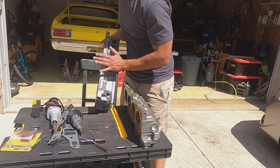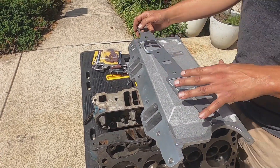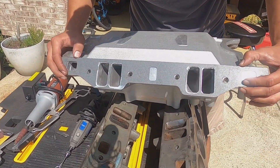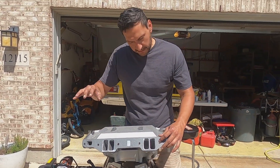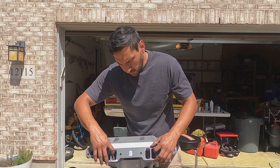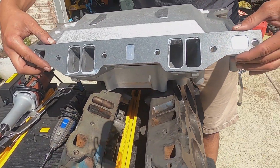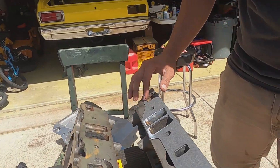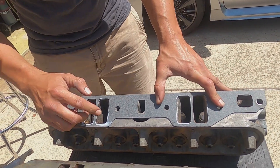Here is my Edelbrock RPM Air Gap intake manifold, and I bought an Edelbrock gasket and matched to that. I probably jumped the gun on it - if I had to do it again I might have skipped this part for now - but it's done, what's done is done. I don't think I'm at the point where I'll get into issues from having low air velocity, we'll just have to see. I did mill a little bit off, but this was already much bigger than the inlet of the head. Since air is coming in, being a little more rounded here is not going to hurt us.